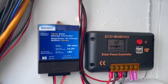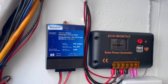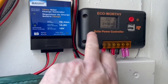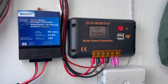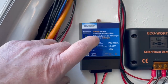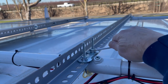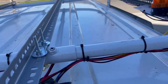When I originally hooked up my solar panels, my 30-watt panel was on this older charge controller. I have another charge controller like this in the front of my van for my 50-watt panel. I ordered a new Eco Worthy charge controller for my 30-watt panel, so I'm getting solar power from that now. This older Sunforce charge controller is the one I'm going to use for my wind turbine. I also had to install a new, slightly longer rail to mount the turbine charge controller.